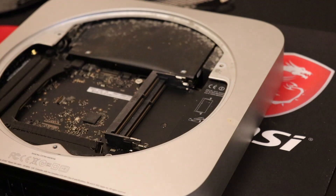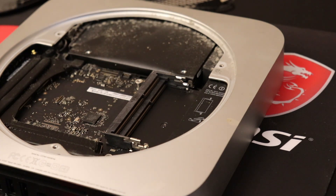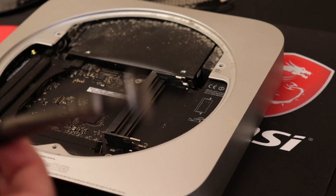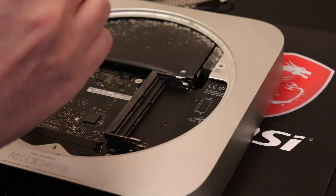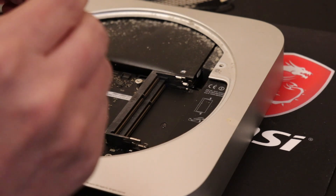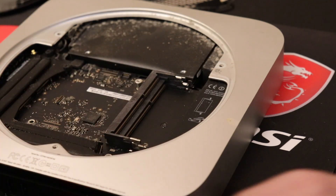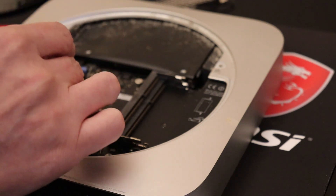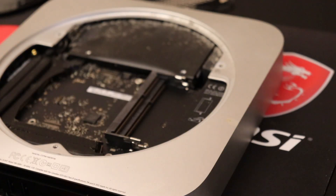As you can see, this is our current hard drive. This one will be staying in here but we're going to put one in underneath. So now I need to remove this T6 screw from the logic board. And then I need to take my spudger and pull up on the SATA cable. We should really have checked that I had the right SATA cable first, because these come in two flavours — let's double check that.